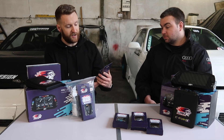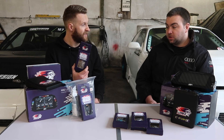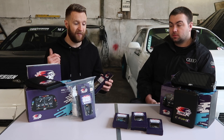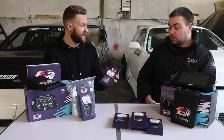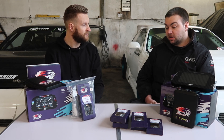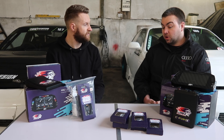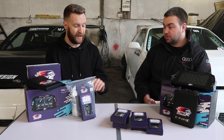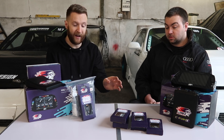Then the next sensor: pressure sensor. This is a smart sensor because it can do two different things — it'll do both fuel pressure and oil pressure; it's the same sensor for both. We took our little analogue gauges off our fuel pressure lines — this is going to do it and display it to the dash, which is awesome. It's worth noting it has a range of zero to 10 bar, whereas a lot of aftermarket gauges only go to about seven bar. A lot of built engines with tight bearing clearances will have that oil pressure higher from a cold start — you could have seven-plus, it could be 10 or 12 bar, and you wouldn't know. That goes back to my point: buy a quality sensor and you will know — it's definitely going to help you in the future.